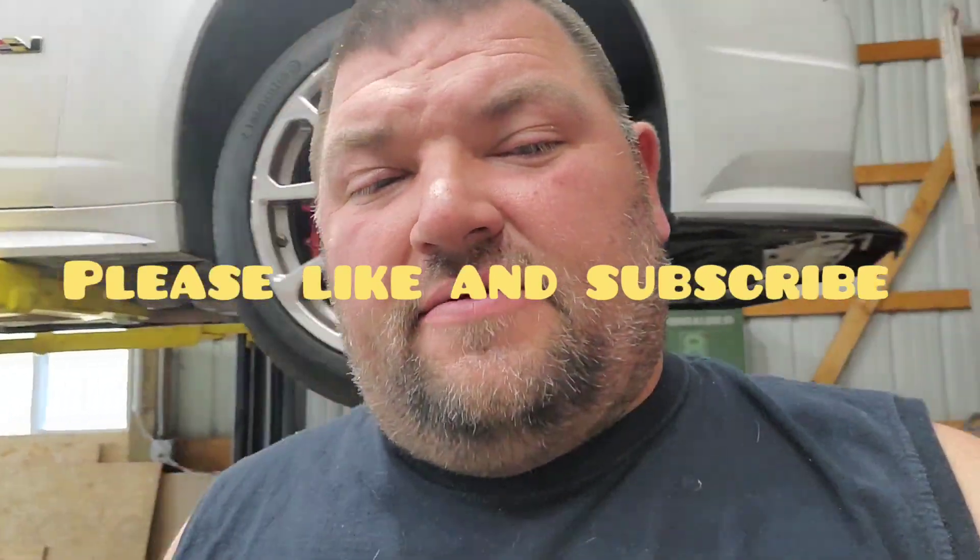Hey, welcome back everybody. I'm going to be working on the V again today. I'm going to be adding a Ballinger AFR500 wideband. I have an MTX or whatever it is, and I normally have good luck with those, but this one has been jumping around — it was not correct compared to the wideband at the dyno. So the tuner suggested one of these.